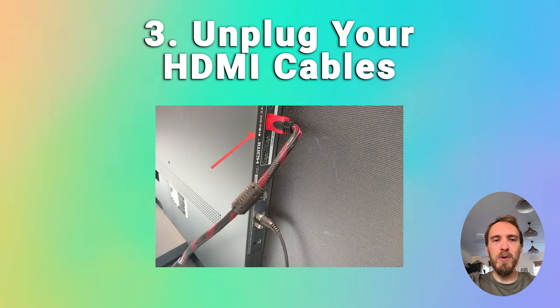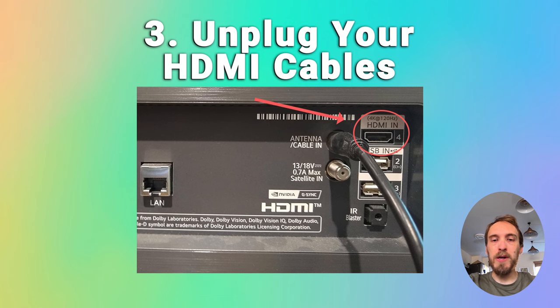You also want to make sure there are no HDMI or external connection problems. Try taking out all of your HDMI cables and all other cables from the back of your TV, other than the power cable, and see if you're still seeing the black screen or the sound with no picture problem. If the problem goes away when you unplug all the HDMI cables, then give all the cables and ports a good clean with compressed air, and try plugging your device into a different HDMI socket — preferably one on another part of your TV, as that should have a separate connection to your TV's mainboard.